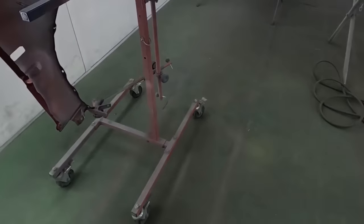On the top side of the door, the tape is back masked. This technique will leave a soft edge right underneath our door jamb area on our A, B, and C pillar. Inside the vehicle, Mario is back masking on the inside of the vehicle so that we can lay down paper on top of it. On the inside of the engine bay, underneath the hood, we use a 36-inch paper followed by 18-inch. We did 18-inch on both sides, keeping the overspray off.